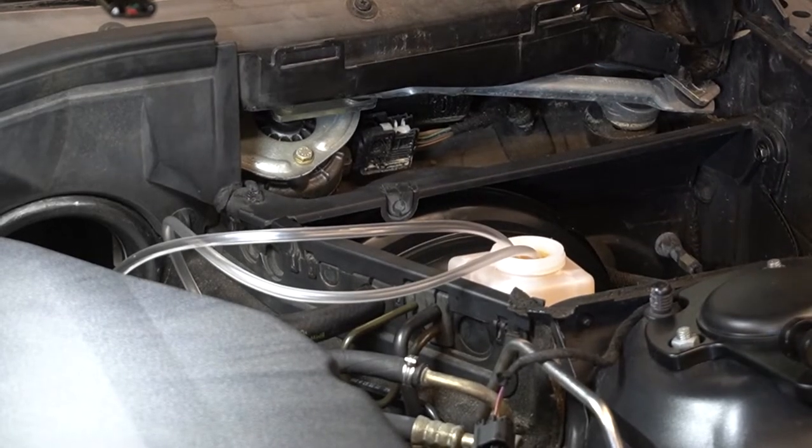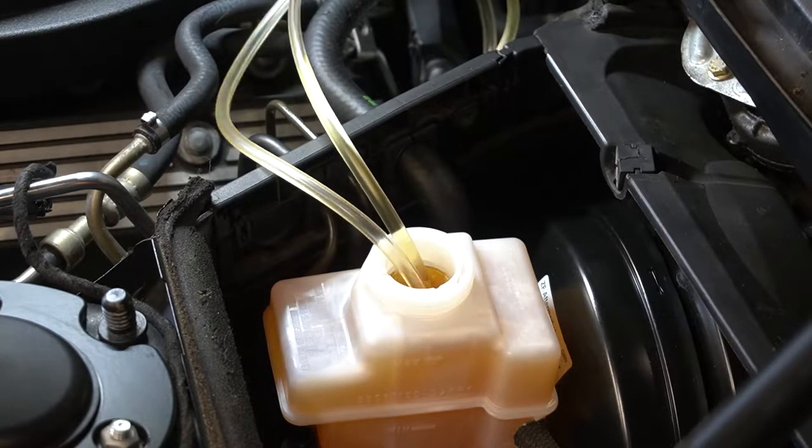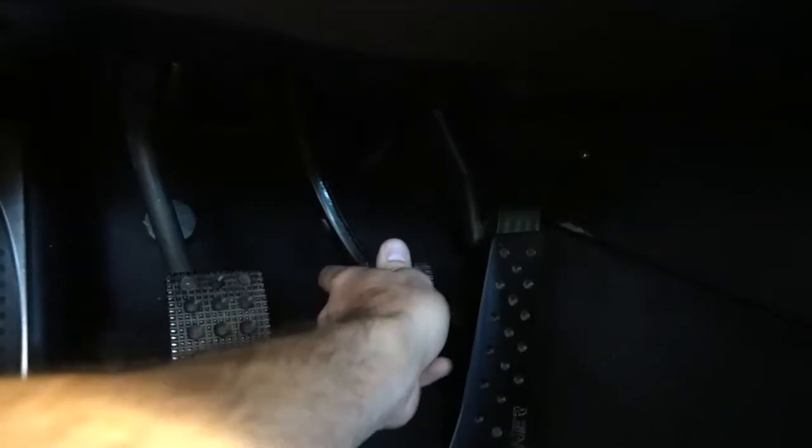It's full — really full. Checking for leaks — no leaks, let's keep going. After about 20 of these little strokes, as the fluid starts to prime through the system you can just start going a little bit longer and it'll start drawing through. It's like skipping over the air that's in the system. Ideally keep doing this until there's just fluid in the hoses — no air.